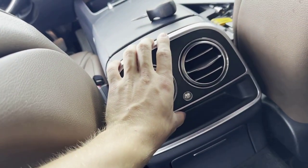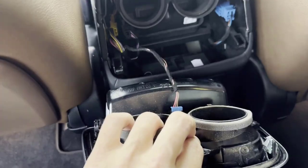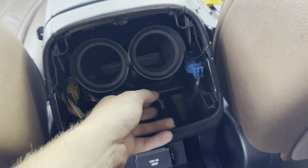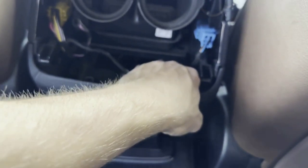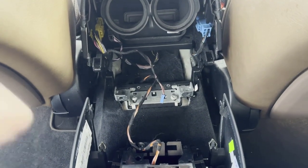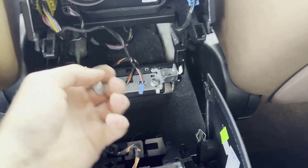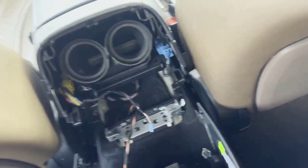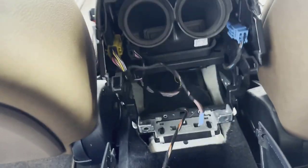You start at the very rear. You're going to pop this back piece off — I just use a screwdriver. You can see in there it just has these little clips holding it in, and that comes off. You can unplug that. After you've removed this top piece, I unplugged this with a little screwdriver-type thing. This bottom piece pulls right out. Now that we've pulled this back, you're going to have two screws in here — these are T30s. You're going to remove both of those and we're halfway to removing this entire console. Those two screws in the back hold this whole thing down.